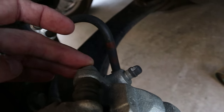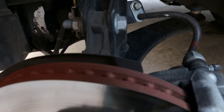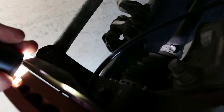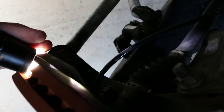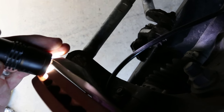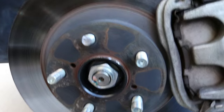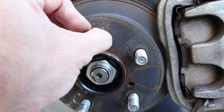I'm taking off this back little bolt to get in there. I think something might be stuck behind this little guard. Looking down in there — there it is! You see that little piece right there, in the corner? Barely visible. That's the rock. It's caught in between there. Once I knock that out, that should take care of the noise issue. The issue it won't take care of is this broken wheel stud.